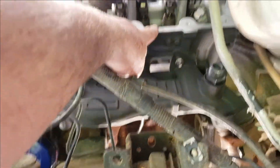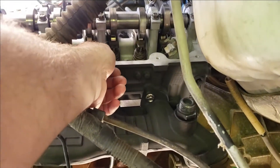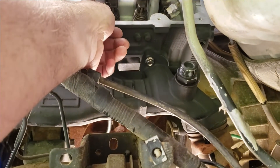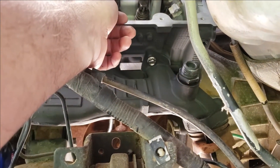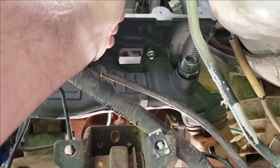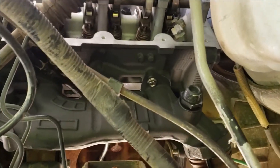Go around to the wheel well — it's this bolt right here, conflicting with the steering shaft. If you'll just pick up on the bottom side of the head a little bit, the bolt will go ahead and fall in as far as it'll go. Put your head back down and the bolt will finish going down into the block and then you can thread it in.